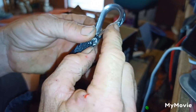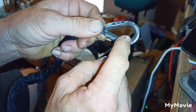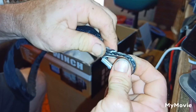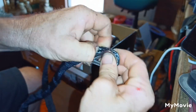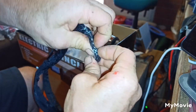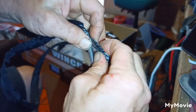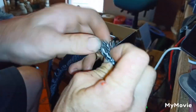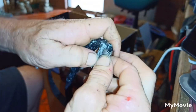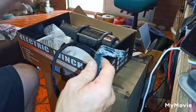This little thimble - now this is really good. I like this because you don't have to cut the rope or pull the splice to get this thimble out. But this bit of metal is something we don't need in our winching scenarios. So we just have to loosen the rope up a little bit and wriggle this thimble out from there without ruining our rope. There we go - get rid of that, throw that straight in the bin.